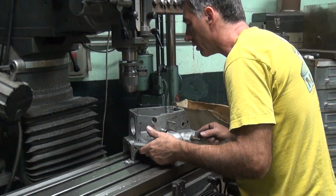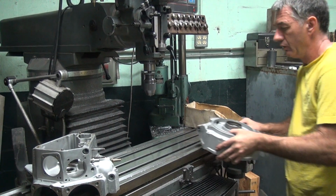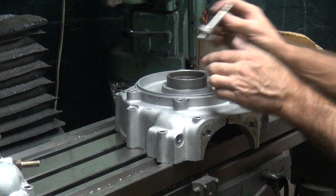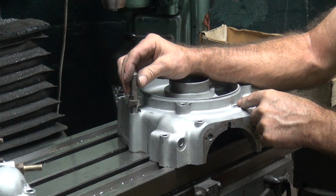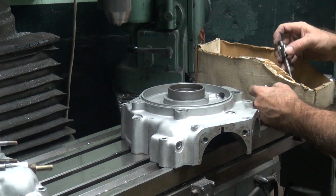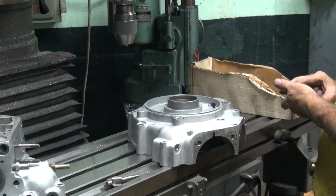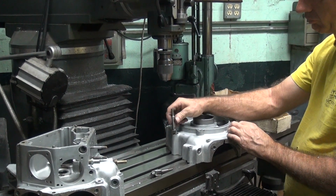In this case, we did everything we could do on this one. Size it is, but see, it cut the hell out of the case. See, it's too big in diameter. Find something that's got a smaller diameter. See, that's too big of a pilot and it doesn't work. There's one there. Looks like it'll just clean out that surface. This is a new cutter too, so it's probably one I made up for doing that hole. There's another one over here, but see, this is a 5/16. So it'll rattle around too much.